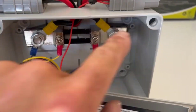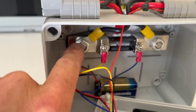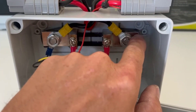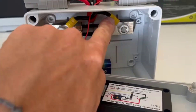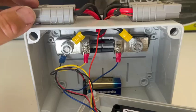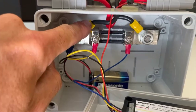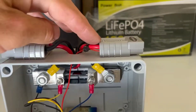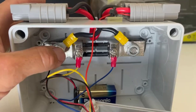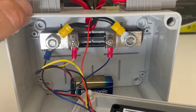The only thing you've got to watch out for when you buy these is the markings on each side. This one says 'FL-200' and the other side says '200 amp'. You've got to make sure you get it the right way around — the side that says 'FL' runs straight to your battery side, and the side that says '200 amps' runs to your outlet, so your loads. Annoyingly it doesn't tell you that on the unit itself, so just make sure you get that right.